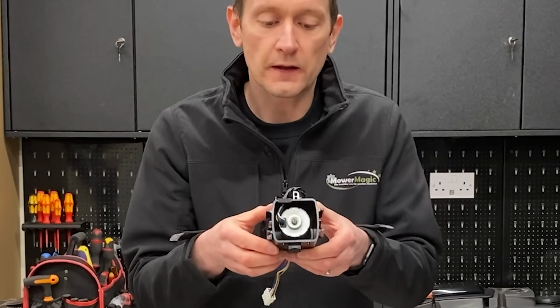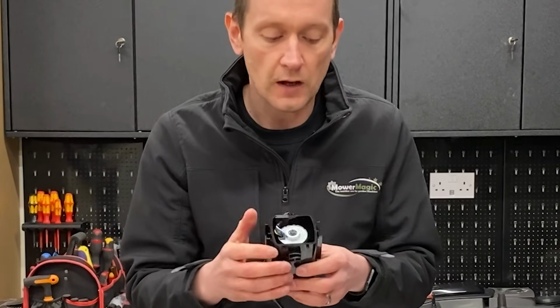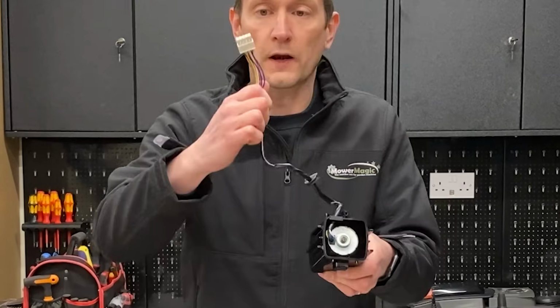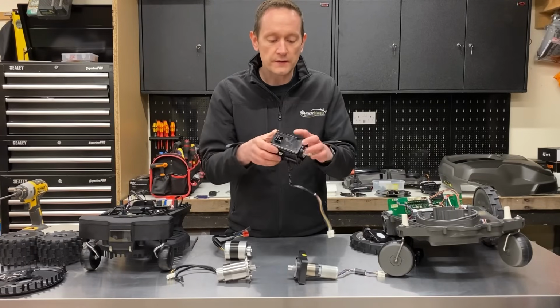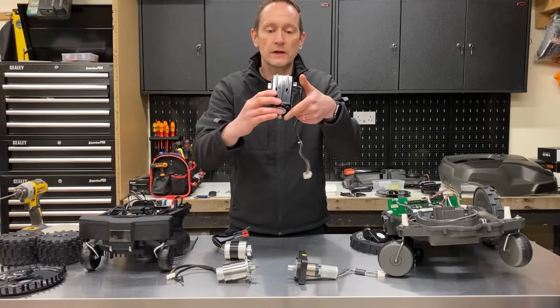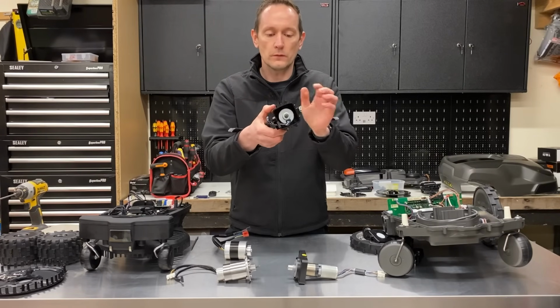So we can see in here you've got a motor. It's the same type of motor as the one at the rear, slightly larger. It's a crimped together design, again brushless induction motor with a single Molex connector for the power and speed monitoring. Looks good quality, nothing wrong with it. You can see the blade boss there where the blade assembly attaches on. So when you need to replace that, you buy the whole unit and it just slots in with the box already attached.